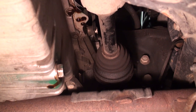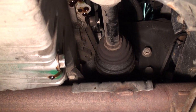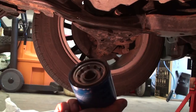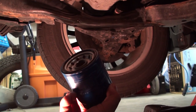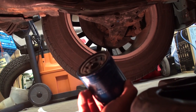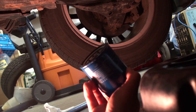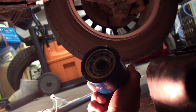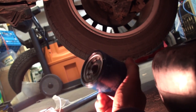Once you've loosened the oil filter with your wrench, let the oil drizzle out until it stops dripping. Have rags on hand to wipe up any mess that runs down the backside of the engine. Once dripping has stopped, completely remove the oil filter and reinstall the new one. Carefully screw the new filter onto the threads to avoid cross-threading it onto the oil filter nipple. Tighten it hand-tight only — keep turning until you can't turn it any further by hand. Do not use any tools such as the BOA or cap-style wrench to tighten this filter, as applying additional torque can damage the delicate oil filter threads.